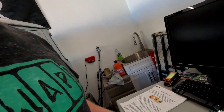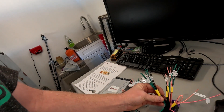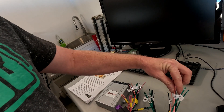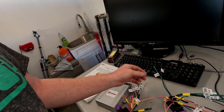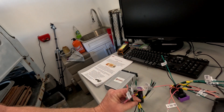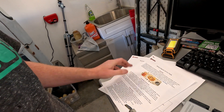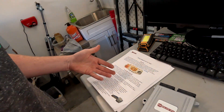I've also been working on the Resolve EV controller — I have the firmware updated and soldered the bridge jumper so that we can use the Leaf throttle. I've also labeled all of the wires that come out of the plugs and bundled them: this is the BMS bundle, over here is the PDM bundle, and then there's the 12 volt and brake relay bundle, the fan relay, ground, ignition, and the throttle bundle. Everything is labeled really nice and neat so there are no mistakes when it comes time to wire it up. The Resolve EV controller instructions are really detailed and have a ton of information about how the system works, which is why I'm using it in the Frontier.